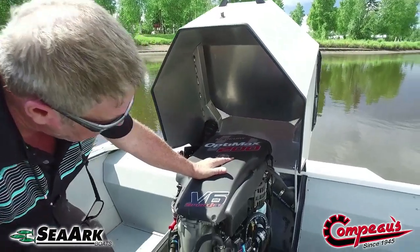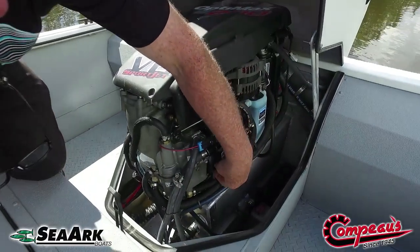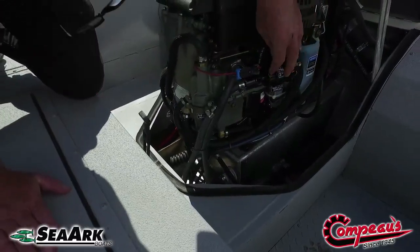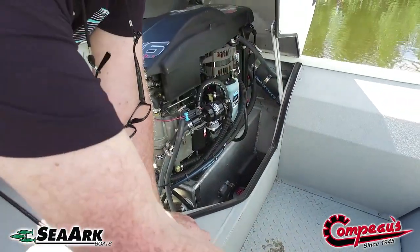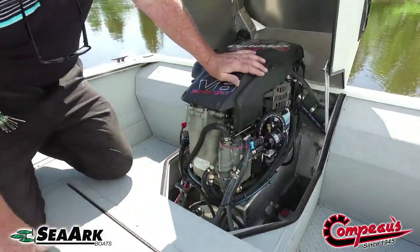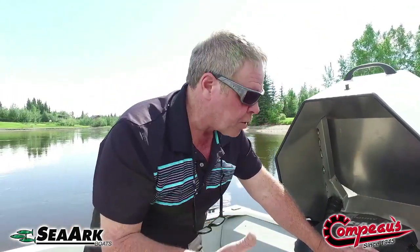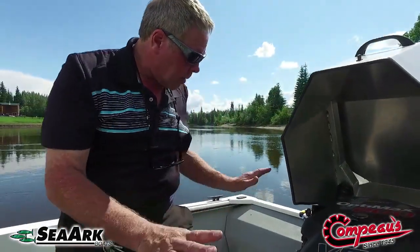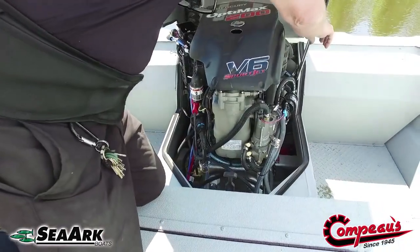It's a pretty simple design and a really good system. You've got a fuel lift pump here, the main fuel filter is on the motor with a sensor at the bottom — if you get water in the gas it'll alert you on the dash with beep codes. This is the on-board oil tank fed by the main two-and-a-half to three-gallon tank, so it runs you probably four to six tanks of gas before you even need to add oil. It's a high-pressure direct-injected two-stroke — the most high-tech two-stroke they make. Good on gas, simple, and been really bulletproof.